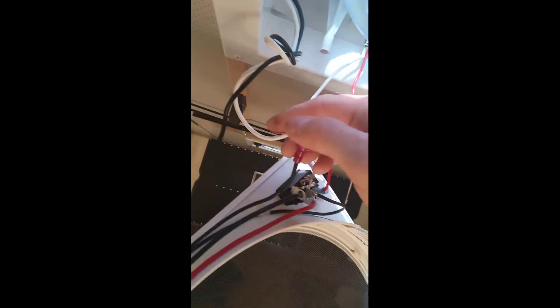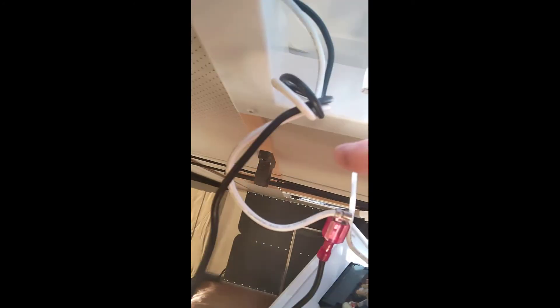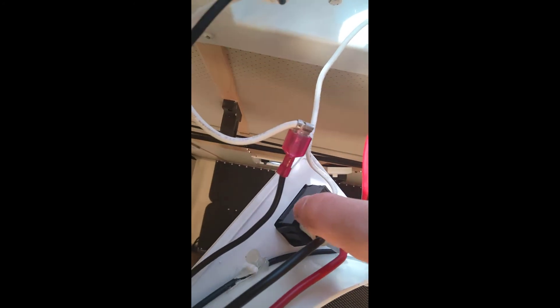My version of the pulse width modulator. These two wires come out initially. Black is hot, white is not on my particular version. The black wire stays in place and goes to the fuse there. The white wire ends up getting pulled off of this terminal here.